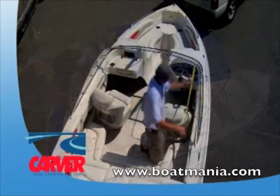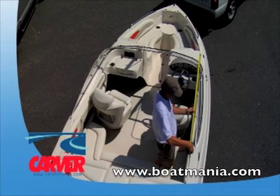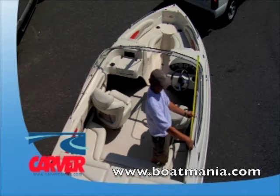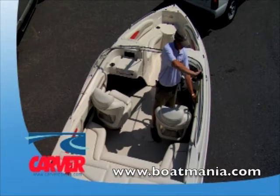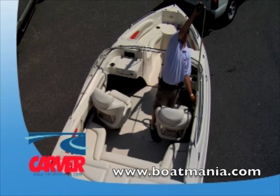This changes for the runabout boat because your mounting points are on the wing of the windshield and are much higher off the deck. You also want a lower, more sleek look on this type of boat. The same general rules apply for determining the height of your top. Measure the distance from the deck to the mounting point to determine the additional height desired for your top.